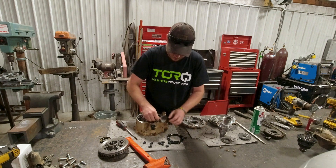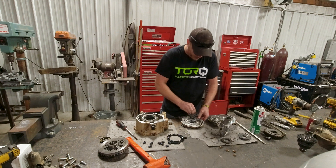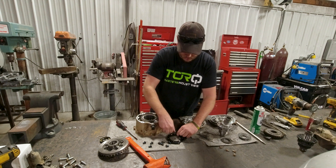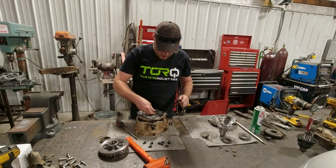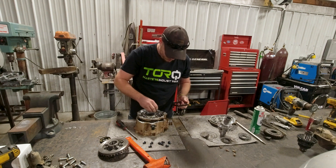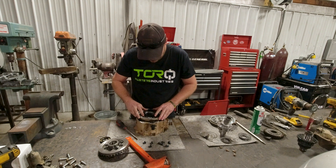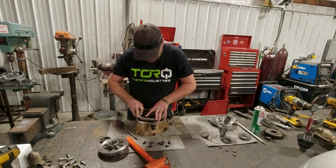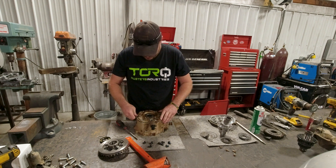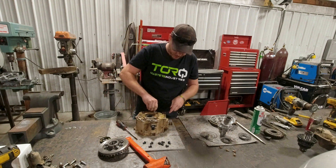We're going to clean this up a little bit and get ready for silicone. I'm not going to silicone this on camera for the sake of time - we're going to do this in a little bit. This is the apparatus that puts pressure onto the clutch pack via that actuator on the side of the differential. All of this stays intact - this is a drop-in setup, so we're going to leave it all there. This side is ready for reinstall. We're just going to mock this up for video purposes to make this quick and silicone it in a few minutes.